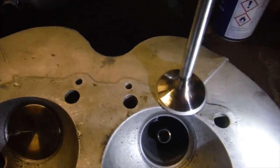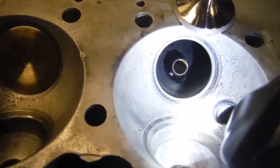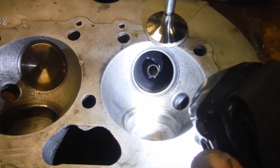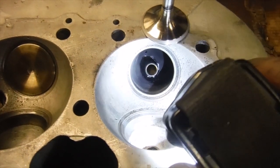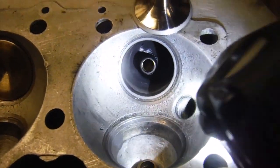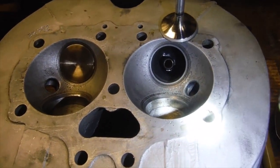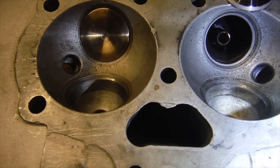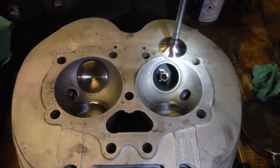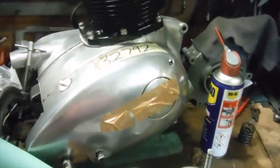Here with what will be the right-hand exhaust valve and seat when the head's the right way up - I've ground these in as well. It took a while before it started making decent contact around this area, which implied the valve seat might have been slightly out of step with the valve and guide. A little more grinding took care of it and we've got a good seating all the way around. That'll be both exhaust valves done. I'll still need to deal with the inlet valve guides and possibly the valves themselves as there's wear on the stems. We'll be halfway there once this valve is fitted. The engine bottom end is built up, so I'm pretty happy with where we are - definitely on the home straight now.